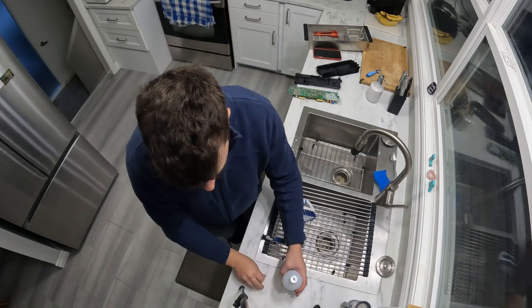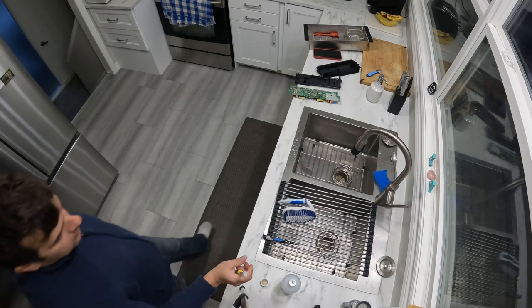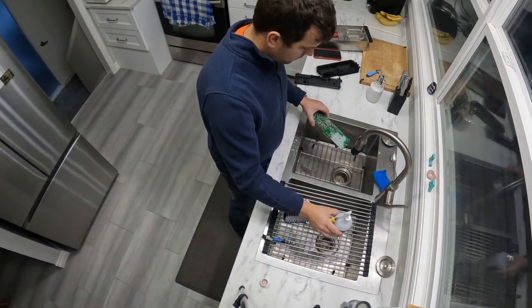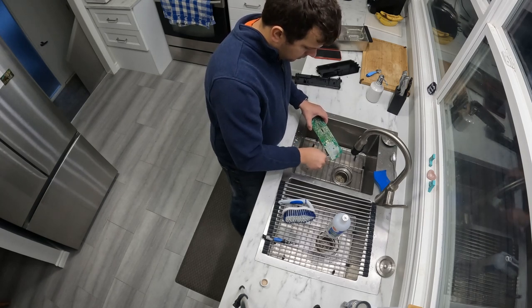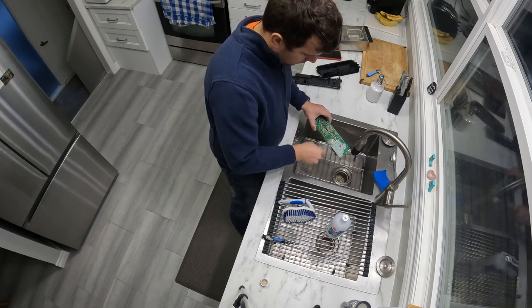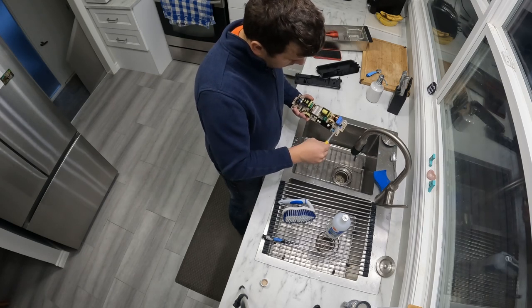Looking at the power supply here, it looks pretty clean, not too dirty. It looks like it's been blown off a few times. But you still got that tarry residue on there from a smoker's home, so it is what it is. I'm going to use some IPA to rinse it down, and use my wife's toothbrush to give it a good scrub down.